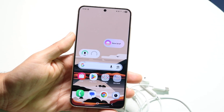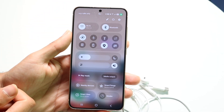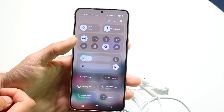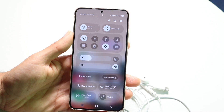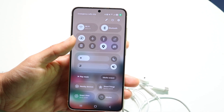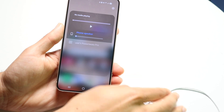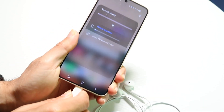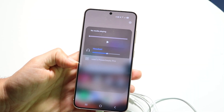If that's still not working, try changing your audio settings. Go into your sound settings and make sure the output — like for media output — is specified for your pair of headphones. If I try plugging it in now, you might be able to see a pop-up for the headphones, and then I can choose those headphones from there.